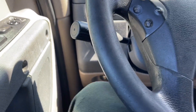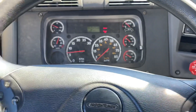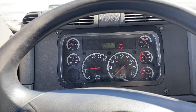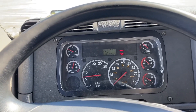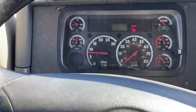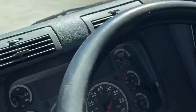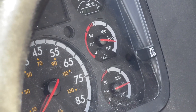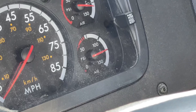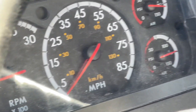I will perform another safe start. I have to put it back in neutral. The air will build to 125 PSI and the air dryer will release. As you just heard the air release from the air dryer, and the gauges were at 125 PSI.